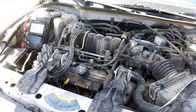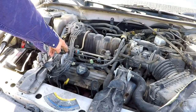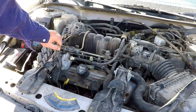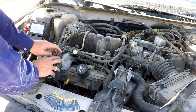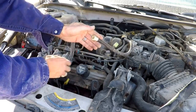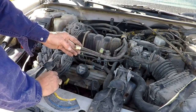Apologies again for the noise. We reinstalled the purge valve and opened up the hood. It's pretty apparent now what the issue is. On this 3.8 liter engine the purge valve is sitting right here, and we found that this hose was not connected — it should connect right here but was just hanging down. Looking at it more closely, this is a push-type connection with two wings that lock it on, and it's broken.